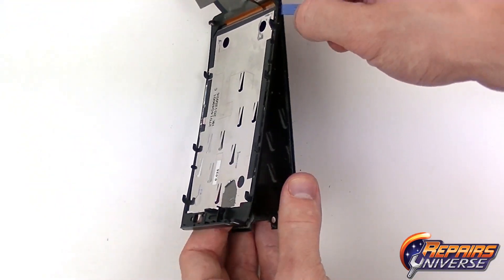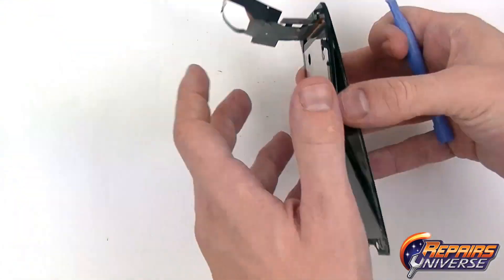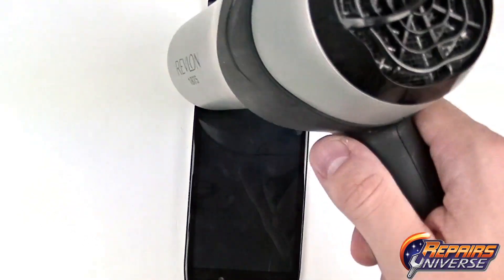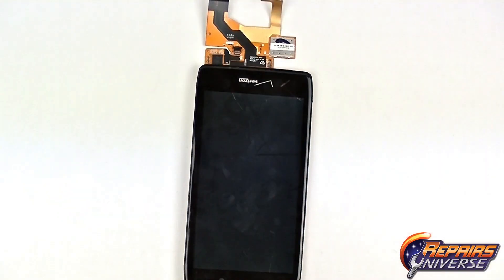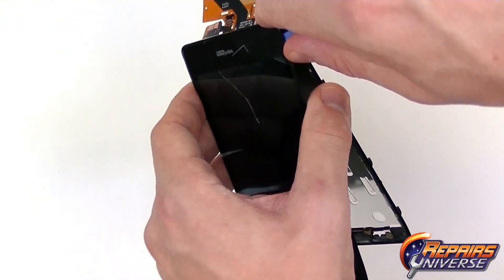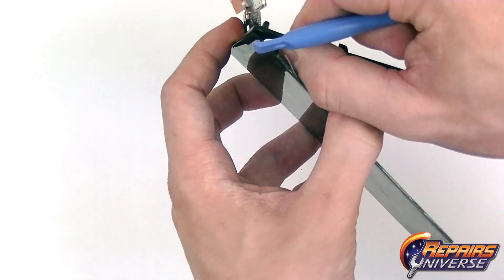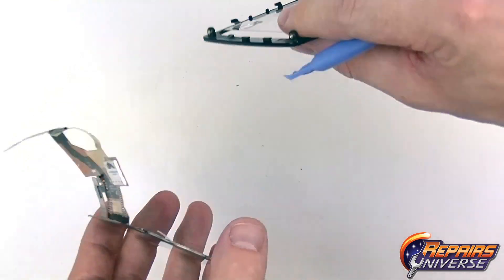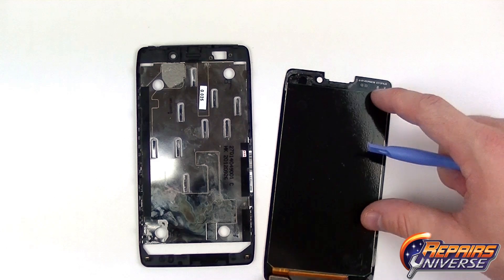As you can see, the adhesive is coming off quite nicely on this screen assembly. We just need to focus down here and make sure to slide those flex cables. We'll reheat it real quick — just a little bit more touch of heat. The majority of the adhesive is on the top and bottom so focus your heat there. With that added heat, the adhesive cuts through just like butter. We're then going to slide that flex cable all the way through the housing. At this point you can replace your screen assembly.